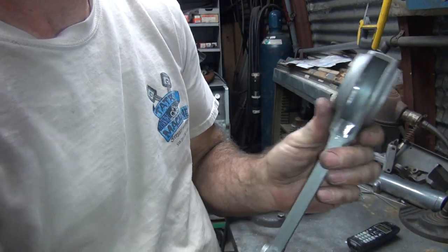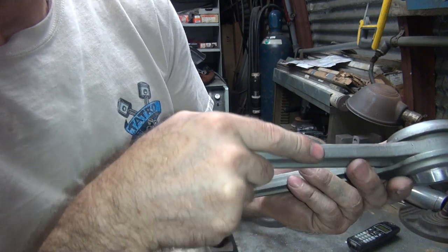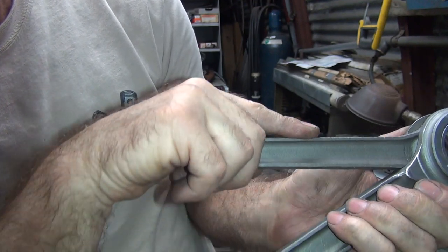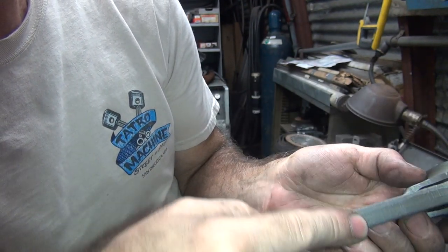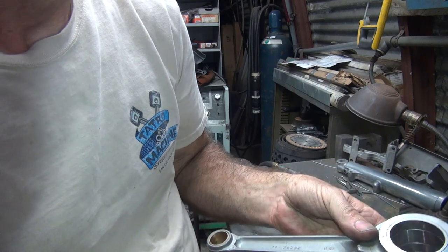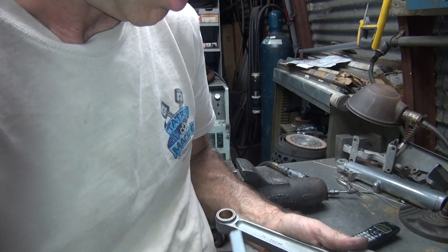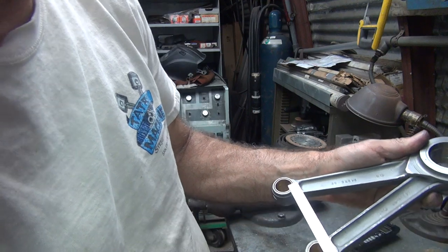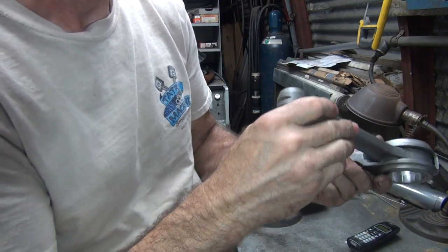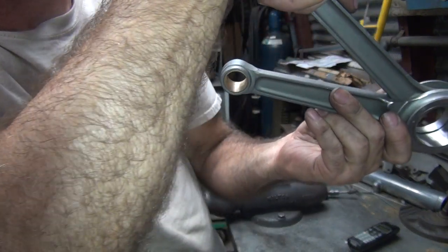A little bit deeper on that side, maybe. Until you cut the spot that's hit and you don't gain much. See, we're down about 3 3/4 now. We gained 3/8 of an inch at least of closing, which is probably enough to do what we need to do, but if I can figure out exactly where we're hitting at.